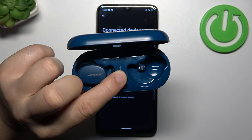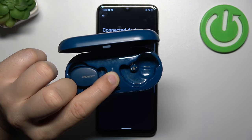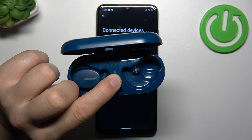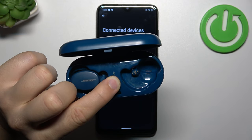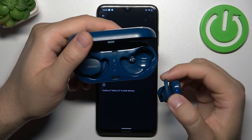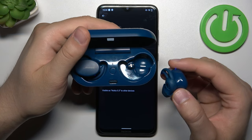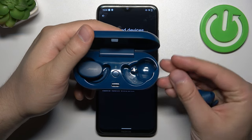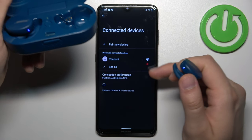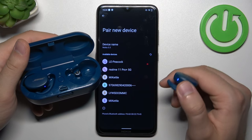Click and hold and keep it close to your ear. You will hear the battery level status. After holding this button for like 10 seconds, you can hear that the Bluetooth list of devices was successfully cleared. When you take a look at the indicators, as you can see, they are slowly blinking blue — it means that they moved to pairing mode.